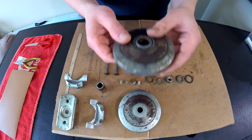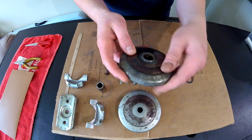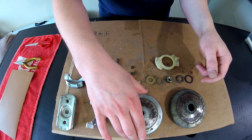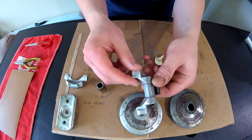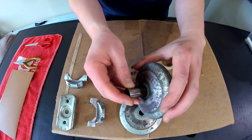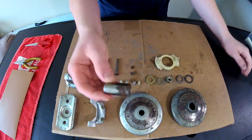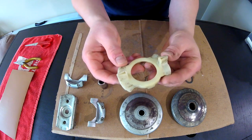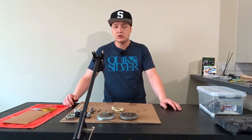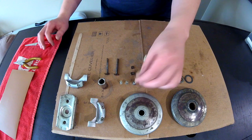As we can see on the dishes — let me call them dishes — there is a lot of rust. This one is better; don't know why, maybe it is a different kind or not from the same bike. These pieces look pretty good, not worn at all. The shaft that's inside one of the dishes is a little bit rusty, which means it is binding up, so we need to clean that. This plastic piece, as I mentioned in the last video, is a little bit worn but maybe in the future when we upgrade I'll get a better clutch or replace the worn parts.